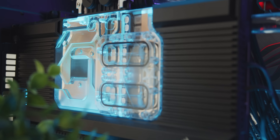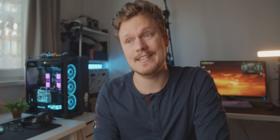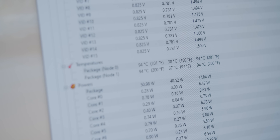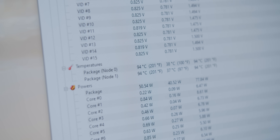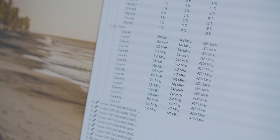Moving on to the custom water-cooled machine: what would happen if the pump failed? This was a complete surprise — I was expecting it to behave like the Corsair One fan failure, but it does not. In just three minutes, the CPU reached over 90°C, which for the Threadripper 2950X is too high, and the processor downclocked itself to 550MHz. That frequency is basically useless — you may as well just shut down. This is at idle, with no load applied. The GPU, on the other hand, remained around 50°C.